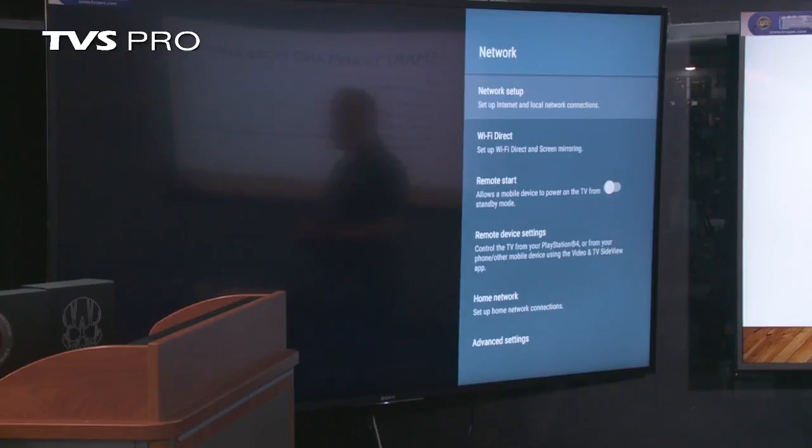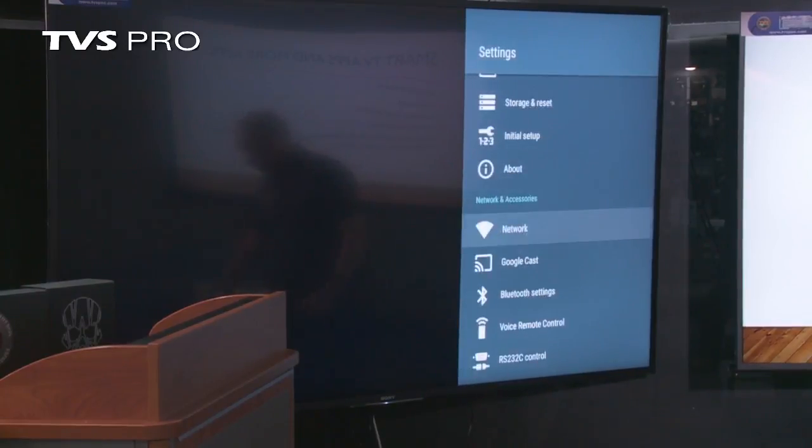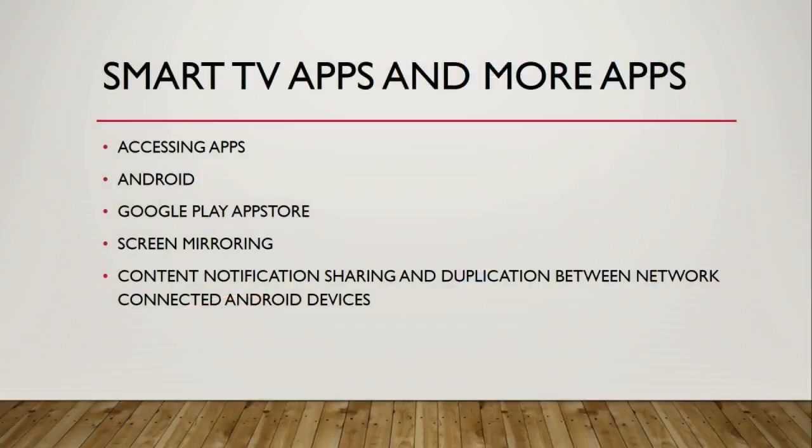After that, you should be able to access all the apps, add more apps, and enjoy streaming videos and content. There's also screen mirroring — if you have content on your phone, like pictures or videos from a vacation, and you want to show it on the big screen, you can use screen mirroring. It uses the Wi-Fi network to stream that, so if you're on a wired LAN, you may have to switch over to the Wi-Fi network for it to work properly. Just be aware that sometimes screen mirroring and the phone control of the TV also use Wi-Fi as a way of connecting.